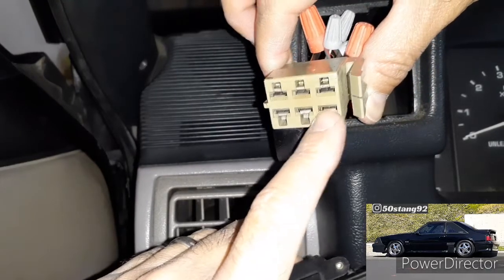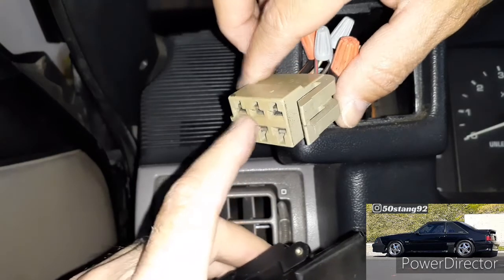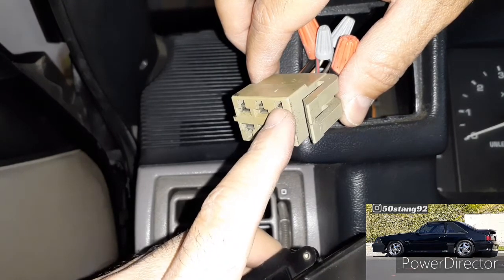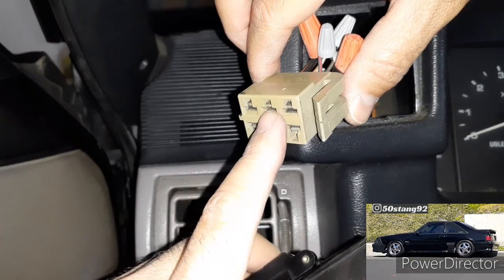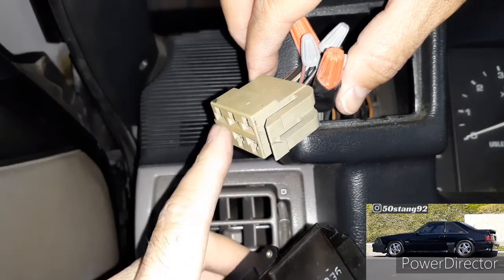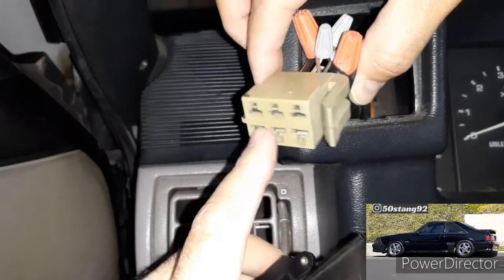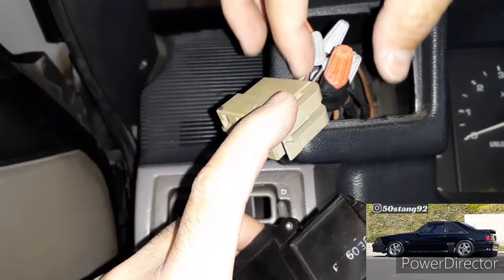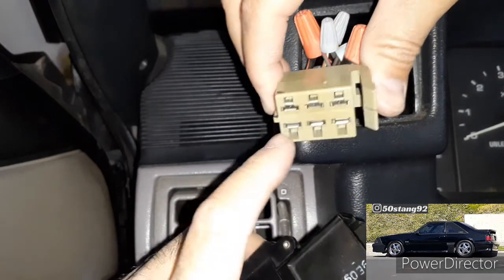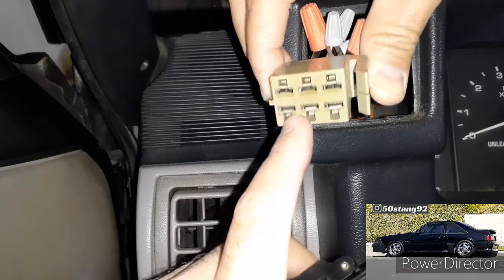This is a newer one I got because the old one was all melted away. That happens over time — that's just how these cars are made with this type of clip. I noticed a little bit of burnt plastic smell coming from in here and eventually figured it out. I got this clip from the junkyard off another Mustang of the same type. I rewired the back of it, taking the old wires out and putting them in exactly matching the same wire colors. As you can see, this one is in good condition with no dark spots from burning or melting.